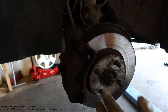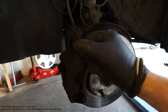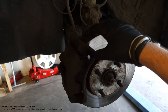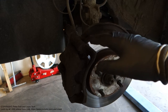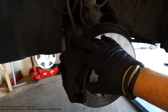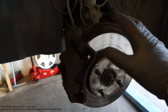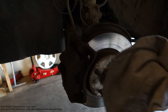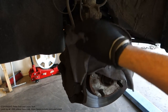disc and brake caliper so that we take a grip here. Please use gloves, because these brakes are extremely dusty and full of poisonous dust. Do not ever breathe or inhale this sand or dust, because it is very dangerous. And do not ever blow any compressed air in here. You can only carefully use a wet cloth to clean and take these sands away,